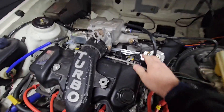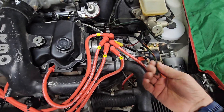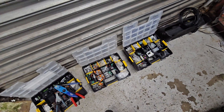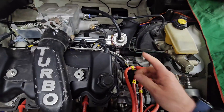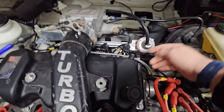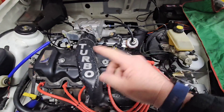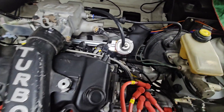Working myself around now, all of my loom is pretty much fitted from the engine-related stuff. I've got an auxiliary connector here with 5 volts, sensor grounds, and various analogue and digital inputs — a couple of outputs too, because you never know when you want to add a temperature sensor or something. So we'll put a DT connector there. One thing I've noticed which is going to cause a bit of drama is the fuel pressure regulator I've just bolted on — it's an aftermarket one. It's become very obvious that the breather system is just not going to work, so I'm going to have to have a bit of a redesign on that.